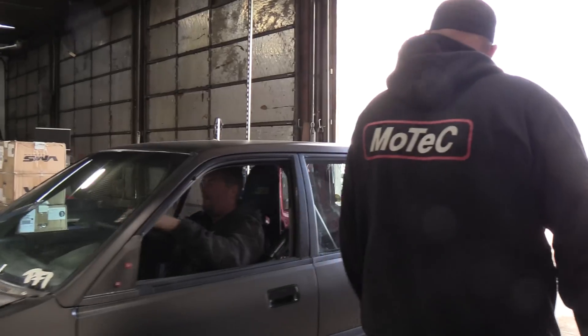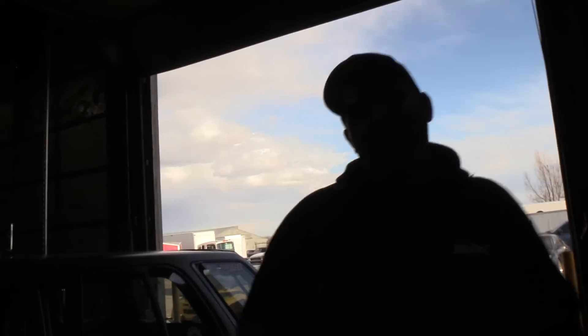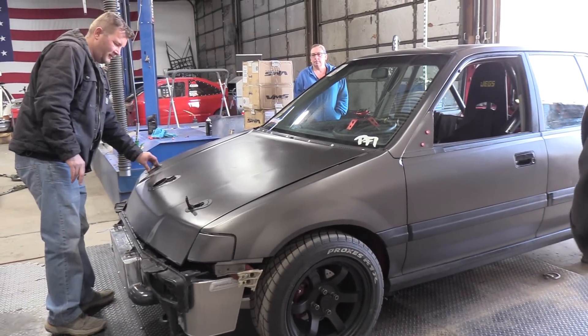James's car — we had some bunk injectors. We got to the track and it started acting real funny; figured out cylinder two wasn't working very good so we called it a day. He brought the injectors by, they weren't working well, so we gave him a new set — brand new ones off our website, reliable. We're just going to double-check everything because the two-step changed everything: idle, everything. We're going to make a couple rips and feel it out.